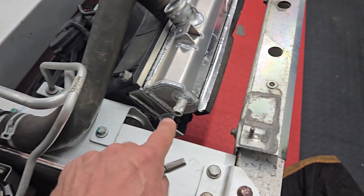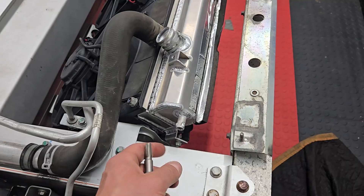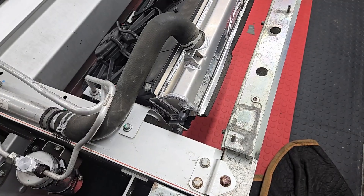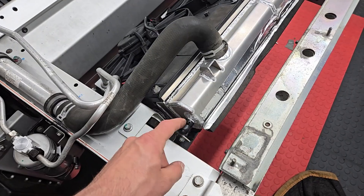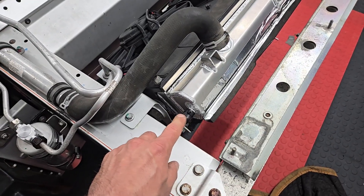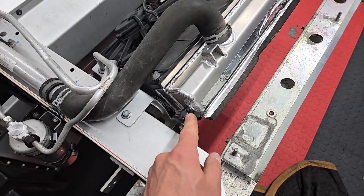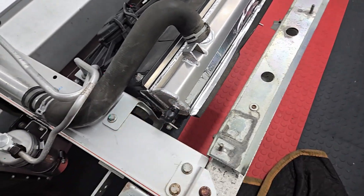What I've done is I got a one-eighth tap and that fits pretty much perfectly in there. You can see I already have the threads cut and basically I'm just going to block it off. I'm going to use green Loctite, which is a sealant — it's not permanent. And then I'm going to put a nipple on top of it for good measure because I obviously don't want this thing leaking from there. So here's the end result. I was worried about the plug falling into the cooling system, so I doubled up on tape towards the end — it's not tapered, just a straight plug — so I doubled up so I could only thread it in so far. Then I put a cap on top of that. So it's plugged, sealed, capped, zip tied. That's not going anywhere.